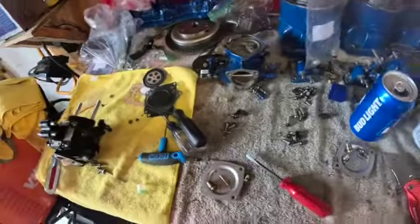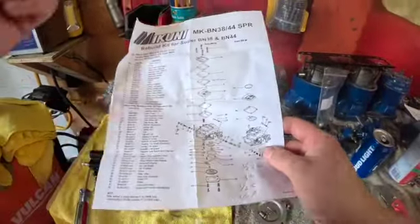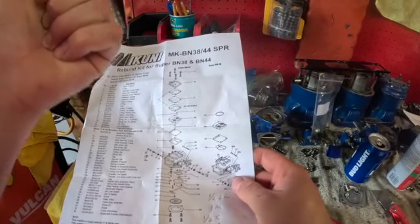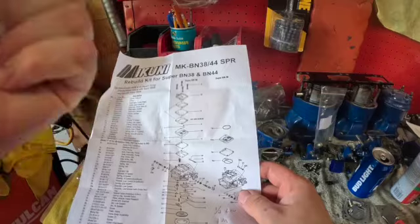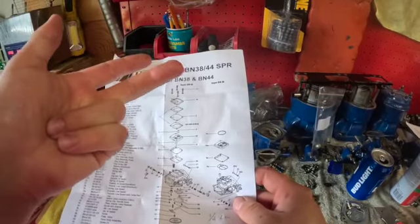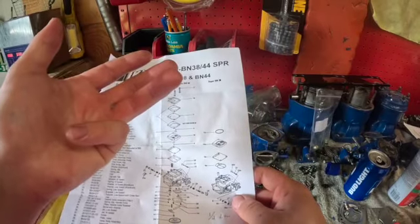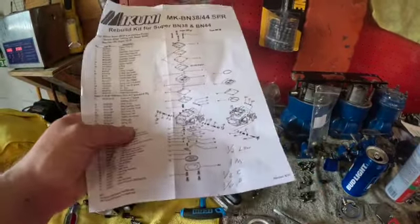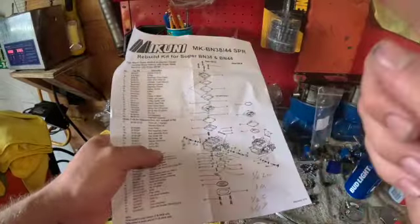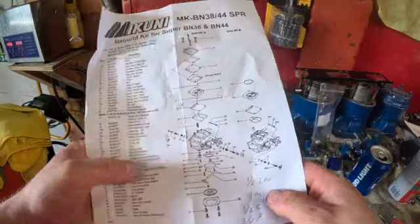One other thing. Okay, now listen closely. I'm running an SL650 pipe. I'm running a gutted air or a gutted water box. I'm running Ocean Pro air cleaners, SLT 780 carbs, and I'm running V-Force reeds and spacers. So, like I said and I mentioned before, 110 for the mains, 67.5 for the pilots.